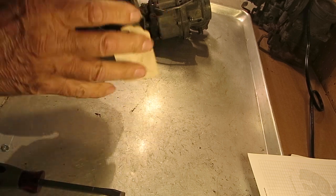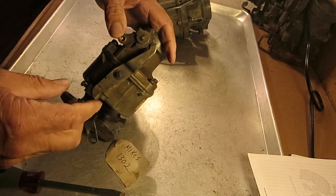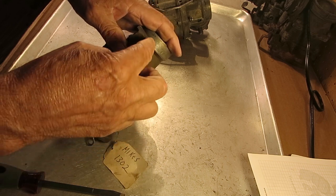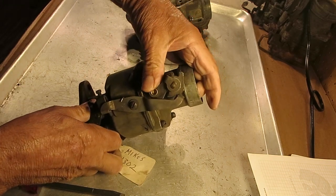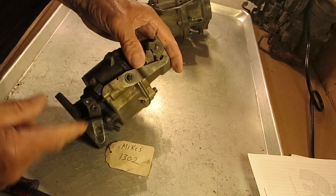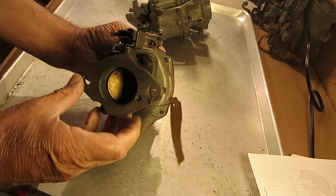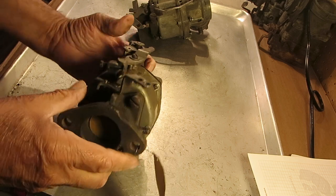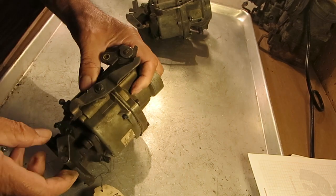You would adjust that when it's running on the car. Now it's closed. So as the choke closes, it moves this fast idle lever — you can see how it moves — and also moves the throttle here open a little bit. So it opens up the throttle. See how it's open right there? And so that's going to make it idle a little faster. That's how the fast idle works on the older B.